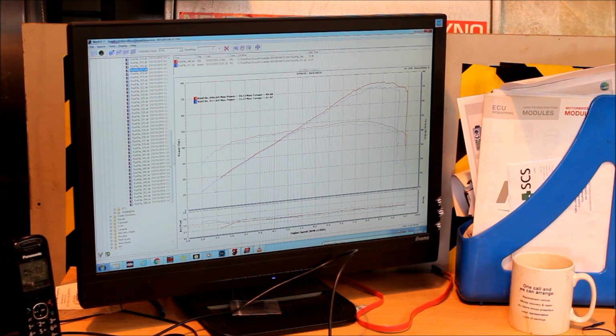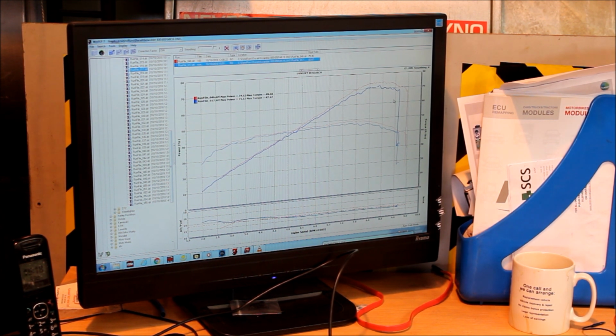Before, the fueling was very lean to start with. It was cracking off from 15 to 1. There was really nothing, it was sort of flat at the bottom. It doesn't look like that much of a gain, but it's going to pick up a lot better. This wasn't actually the highest recorded run, that was the highest recorded base run, run 17. You can see it smoothed out a lot as well. Yeah, it was a bit erratic. Nicely improved at the top there.